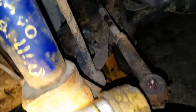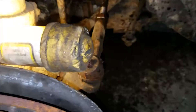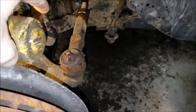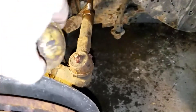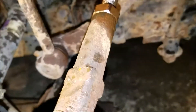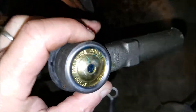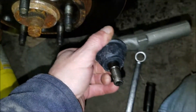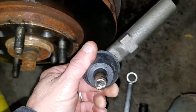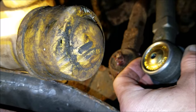I'll go buy a new tie rod and go through the steps. The thing is, when you change a tie rod end you're gonna have to have it realigned, but you can temporarily get it somewhat close to where it was. With that lock nut I'm going to go counterclockwise, and I'm putting some Brake-Free penetrating oil on it. You want to try to find a tie rod end that matches the old one — I picked up this Moog at the parts store and it appears to be the same as the old one.